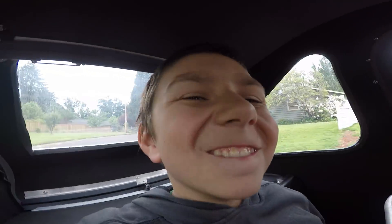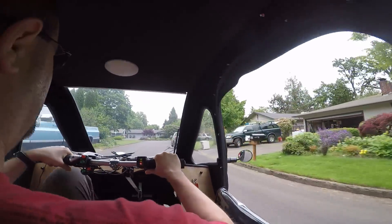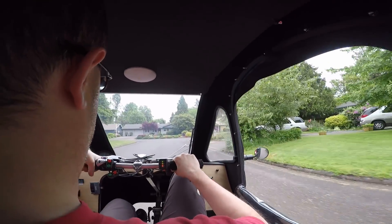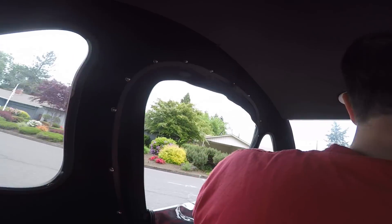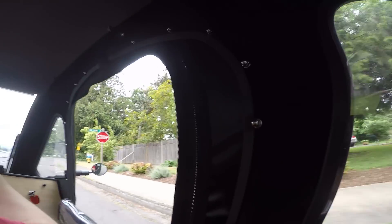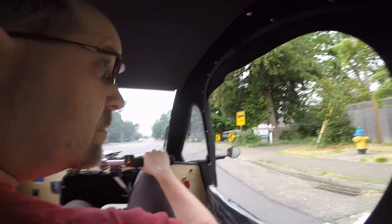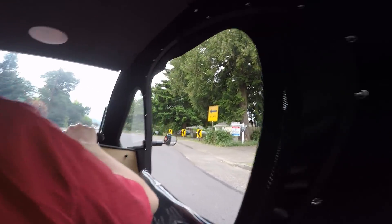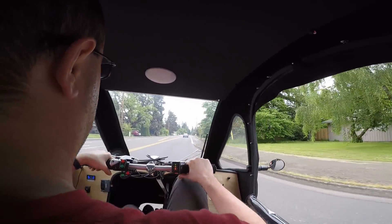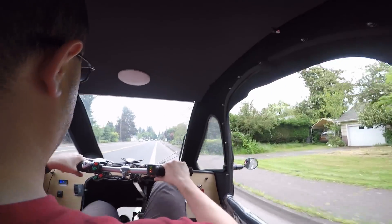On the new system with the electrical, you've got a 750-watt switch and a 1500-watt switch. What that's going to do for you is it's designed to be an on-road/off-road setting. Like when you're not on the road you can run the 750 — if you're in a bike lane or on a bike path you can run the 750 so you're being legal and you're a bicycle. But when you're on-road, assuming you have a driver's license and all that, then you can run the 1500.